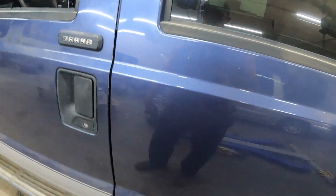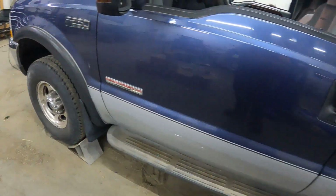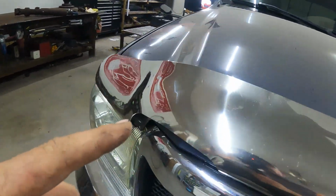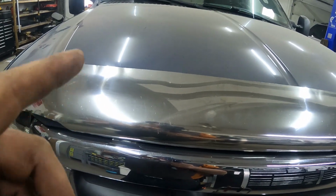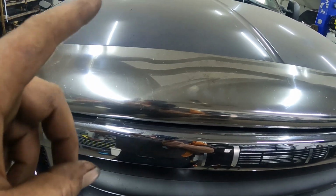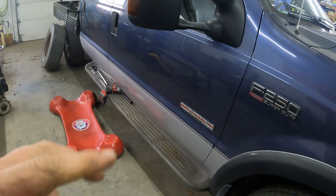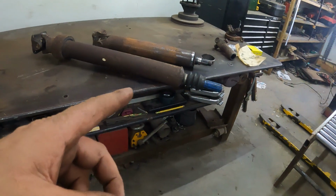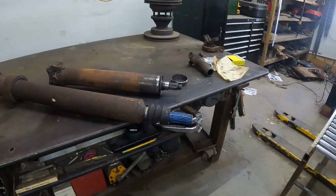But I drove it outside, drove it back inside, and heard some grinding noise. While I was putting this together, if you mount it in the original engine spot, where the engine mount goes in the cross member, the transmission goes back about an inch, not quite. So when I put the drive shaft back on there, it was making a grinding noise because there was just too much compression on the whole shaft. It fit, but it was not nice.